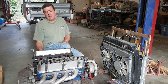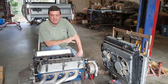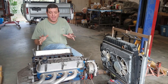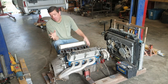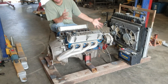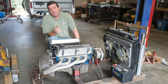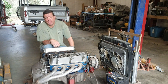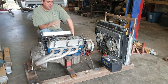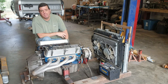I ordered new Bronco ceramic coated headers, and from past experience, brand new headers specifically tell you not to break in a cam with them — they need to go through heat cycles, but when you're breaking a cam you've got a constant load on it. This old engine with the freeze plugs pushed out is just a block, so don't freak out when you see it all open. It needs everything.